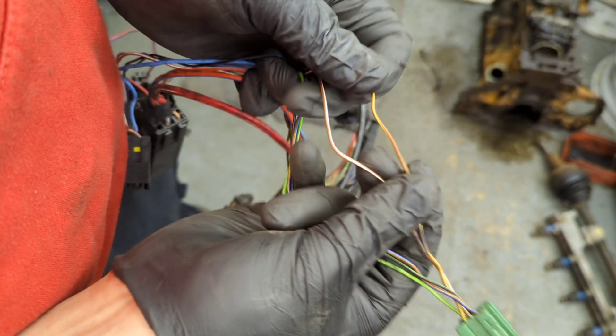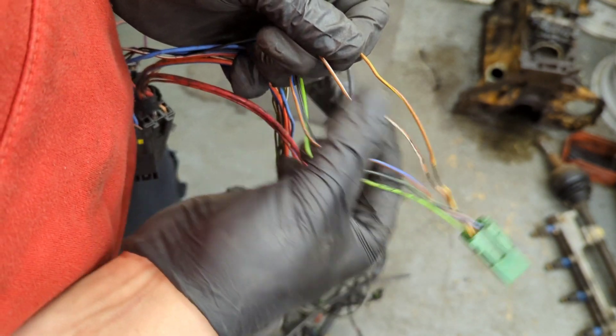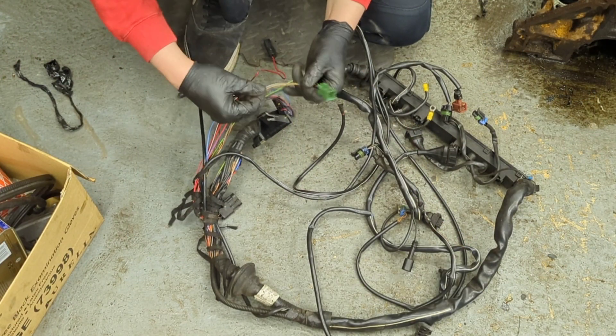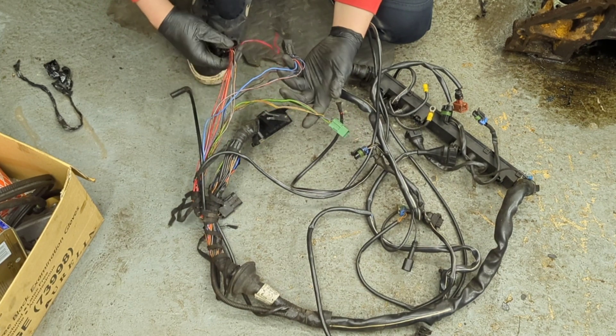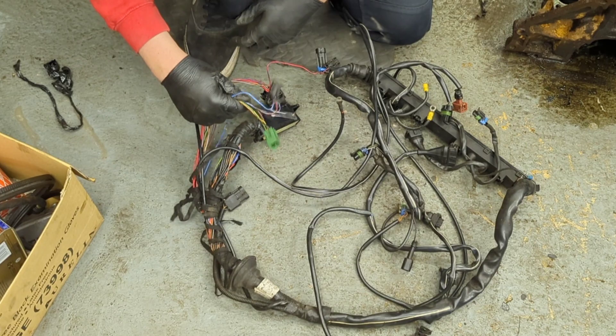For your gauges: this green plug - the green wire is for your rev counter, that soft blue wire is for your temperature gauge. The brown and white and brown and yellow are for your diagnostic light and diagnostic earthing to make your fault codes come up. I think from memory that is it for the basic wiring connections.